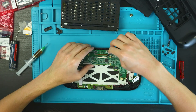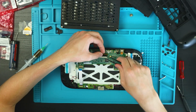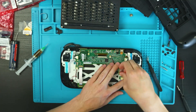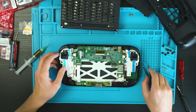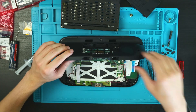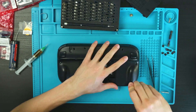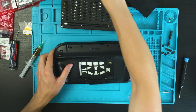This area is covered up so I've got to fish the cables out — probably shouldn't use metal tweezers for that. Getting one locked down and then it's just plugging everything back in, so I'm going to time-lapse through this. The slider goes back in here, plugging everything in as I lock it down. Then remembering to screw in the three board screws before closing up, swapping to the tri-wing, and getting the harder ones first.